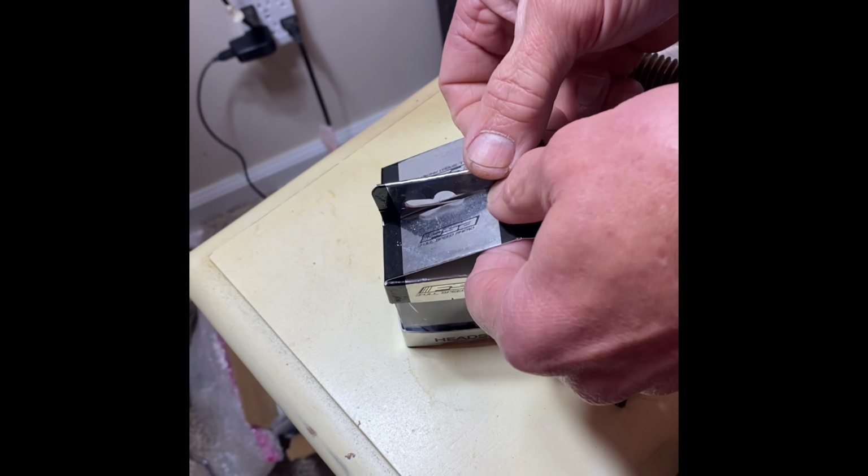So this is a 34mm headset. There's different sizes. That size is this inside diameter right here of the frame. Basically you can take a pair of calipers and check the inside, see what the size is. Okay, and that's how you determine what size you need. There are different size frames. They do come in larger sizes and smaller sizes if you have a 1-inch headset.